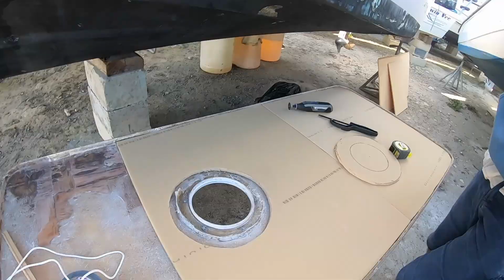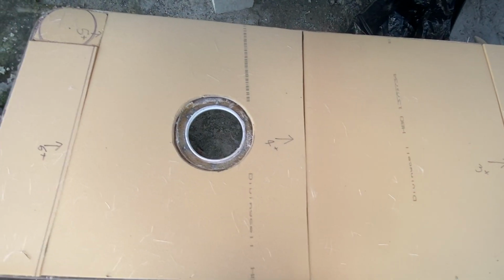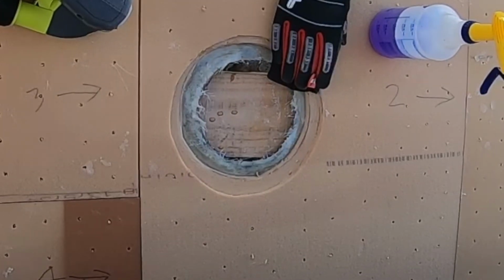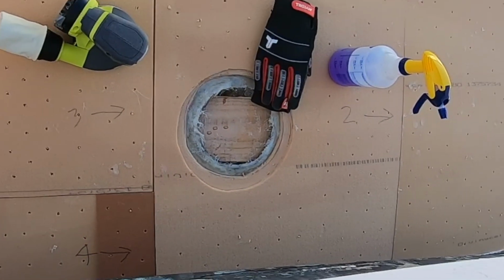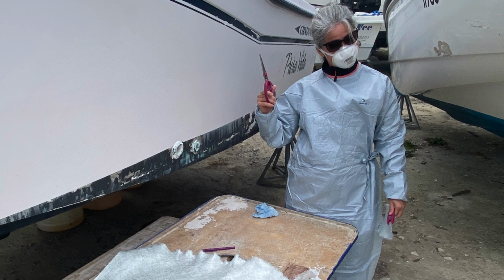As the foam didn't fit the hatch shape exactly, we cut smaller pieces for the 2 layers and made sure that the joins or butts on one layer were over solid material on the next layer. The foam core was sandwiched between layers of 1708 fiberglass.